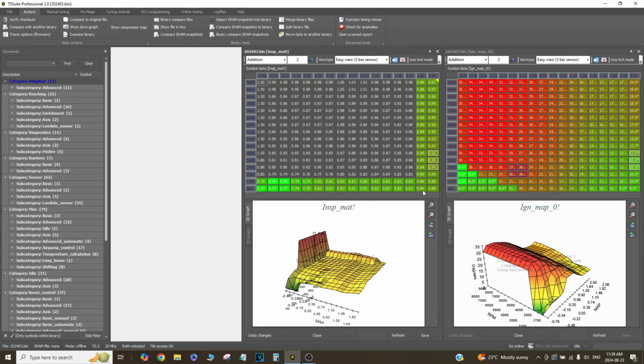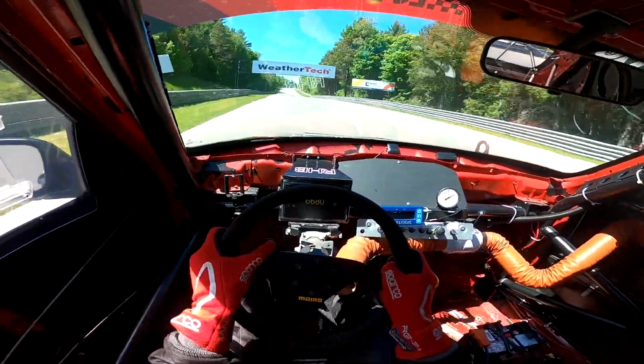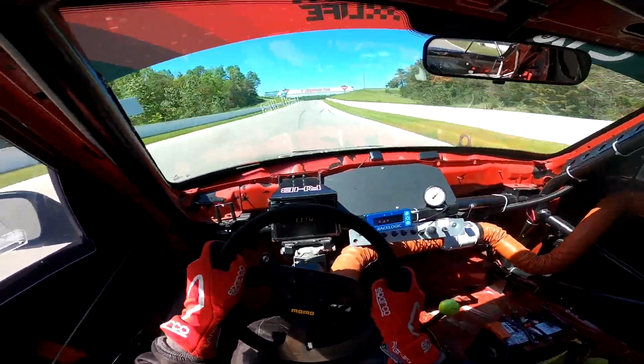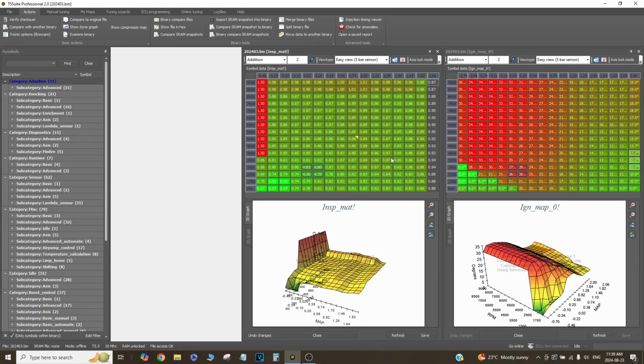The last thing I'm going to say about fueling is air-fuel ratios. Because I run far back injectors, because it's race gas, because of everything with the setup, I actually run 0.90 lambda in high boost all the way up to 0.95 lambda. The car actually touches 1.0 lambda at times, even on the Mosport long back straight. And it's fine because, again, the car has really good fuel vaporization because of the injector location, and I'm running race gas, so you can run it super lean.